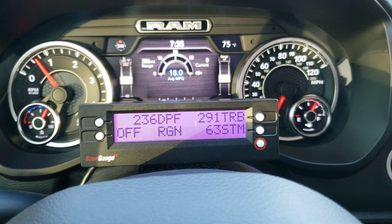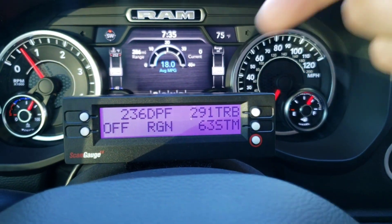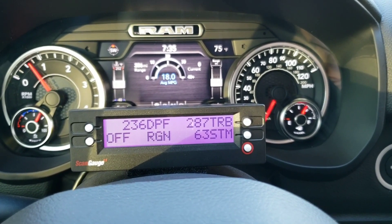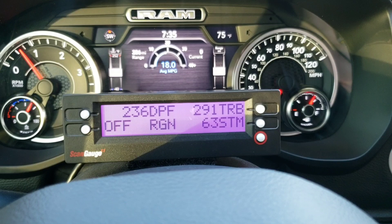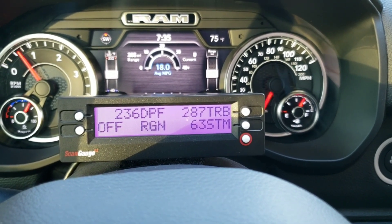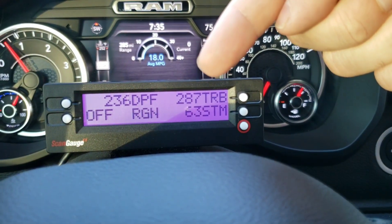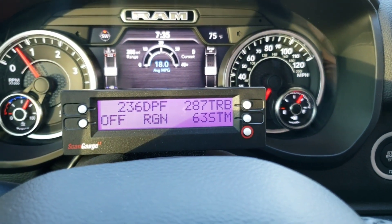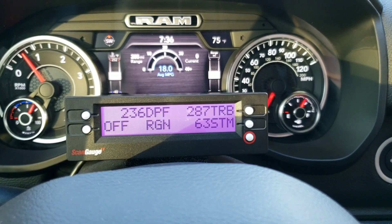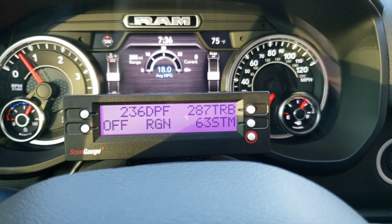You can kind of monitor the conditions that cause the DPF to burn itself clean. The turbo temperature is really helpful because on a turbocharged vehicle, you don't want to shut the engine off if the turbo is too hot, because then you can get oil coking and all those bad things. Even in the owner's manual, they tell you that you need to let the engine idle for a little while before you shut it down if your turbo is really hot and you've been working the truck hard. But it doesn't give you any specific parameters — this helps you see exactly what the temperature at the turbo is so you know if it's safe to turn it off or not. This will easily exceed a thousand degrees if you're working the truck, and even driving down the road in the heat with no trailer on, it was in the seven and eight hundreds a lot of the time. It's very easy to get the turbo super hot.